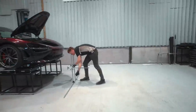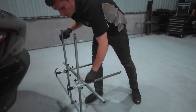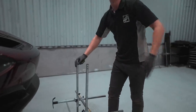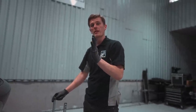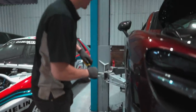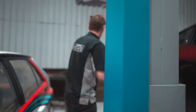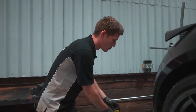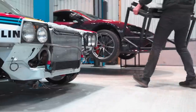What's this, like a little jig setup you've got? Yeah, string and line kit. It's a frame we attach to the car. We then get the frame measured perfectly with the centre line of the chassis so that the string is perfectly parallel, and the wheels are sat inside of that doing their own thing. We measure to the front and the back of the rim, and then we can take the angle measurement. These bars have machined grooves in. Right, so you go for option 2 because yours is quite wide. This is the front to back. This kit's currently just sat on the car. When the strings are run on, I can start going around taking measurements from the car to the string, to the poles, to make sure the kit is calibrated to the centre line of the chassis.